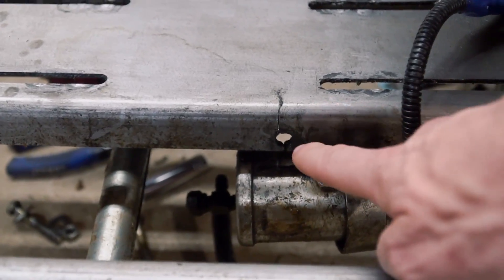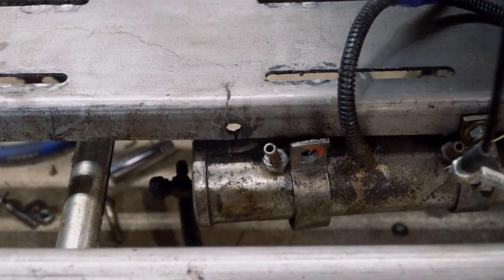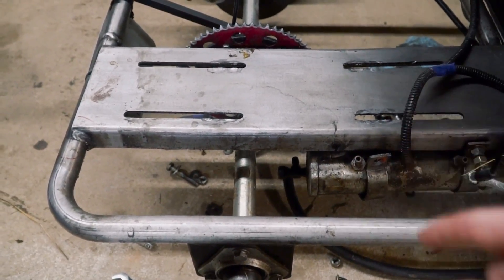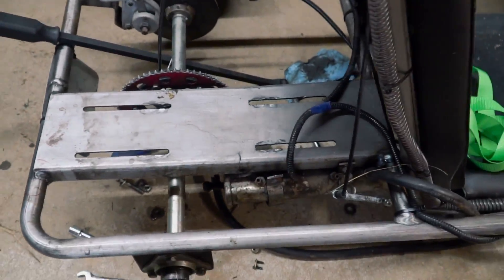There's the crack in the engine plate — we had to drill a hole right there for a catch can and figured it would be fine. Not so much. It probably would have been just fine if we didn't have that hole in there. So Ike's got to hold it while I weld it, and then we have a cross brace going right underneath the engine plate for further bracing.